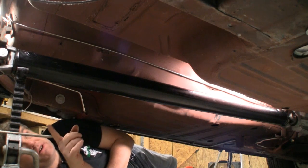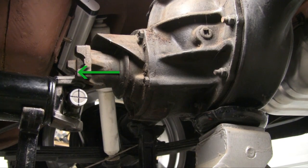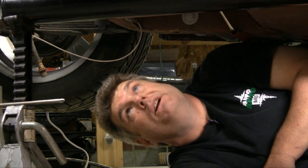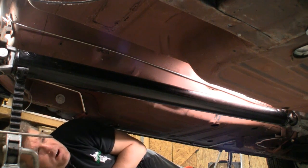When doing a drive shaft mounting like this, make sure the axle in the car is the one you're going to be using. Some axles, like the 9-inch, have different pinion depths from the mounting face to the back of the pinion flange. You want to make sure that depth is exactly the same from the pinion to the very back of the axle housing. If it's not, the drive shaft will have to be re-shortened or possibly lengthened — so look out for that when putting an axle in a car.